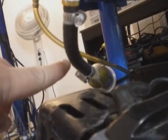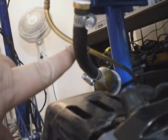It actually just travels up. Then normal fuel line operation going down. It goes to the fuel filter. All the gas gets filtered, and then the return line, when you push the primer valve, the fuel comes up this line and then just goes back in. So you don't have to put an extra fitting on the fuel tank. And it works great. So I put a shutoff valve. It's a marine type, just for longevity, and also when I want to change the fuel filter, I'm not going to leak, I don't have to drain the whole gas tank to do it. Just shut off the valve, so that helps. That's the main purpose for the fuel shutoff valve.